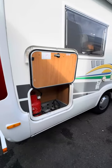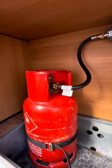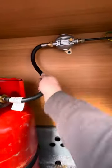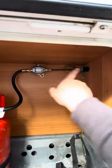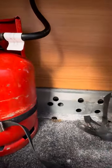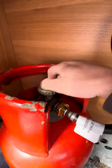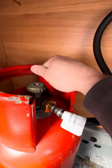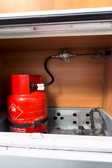This cover on the offside is the gas locker. At the moment there's a single six kilo propane bottle in there. It's a nice simple setup — you've got the pigtail hose going straight to the regulator, which goes straight into the vehicle. There is space for two six kilo propanes if needed. Anti-clockwise on the top turns the bottle on; clockwise turns it off. Turn it off when you start driving and turn it back on as you park up.